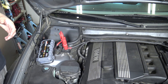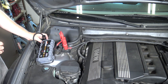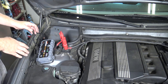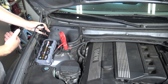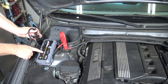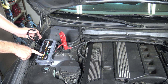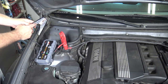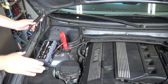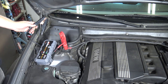Now, if your battery is completely dead — you're trying to start a car that's been sitting forever — you're going to have to get into override mode. You can't get into override mode when it can detect that there's a battery there. So in order to get into override mode, you disconnect from the battery and hold down the red button with the exclamation point. It goes into override mode — the white light starts blinking. This is when it's dumping full power into the cables. If you touch the cables together they would spark because it's full power output. This is complete override mode. You can go ahead and start the car with your fully dead battery.